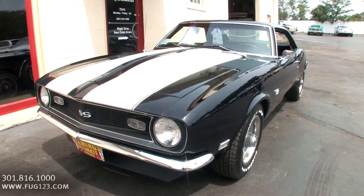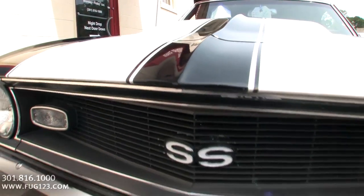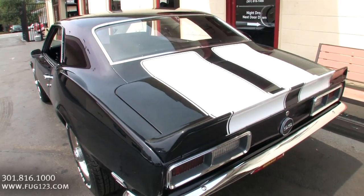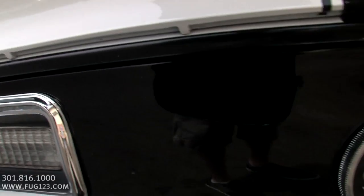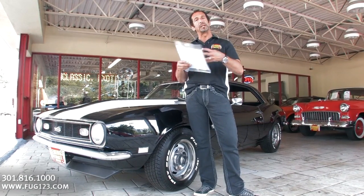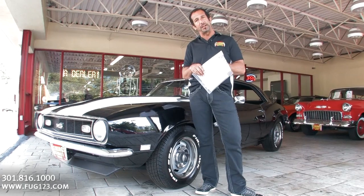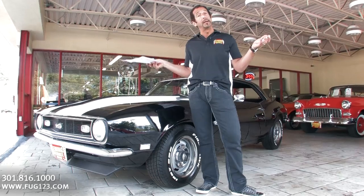One of those things I love is tuxedo black paint. You've got to love black paint. Everybody says they want a black car, but you have to put a little effort into getting a black car to be a beautiful black car, and I want to show you why. Most people don't understand — it's not the paint you put on the car that gives you the black. Most of us can probably paint some black on, wet sand out whatever dirt and dust is in there, but really it's the body prep. It's what gives it that flat surface so the black paint can really reflect off of it. I get teased a lot because I show the paint quality of the car, but that's actually my signature. I want you to see if you're getting an ugly paint job — you need to know it. If you're getting a great paint job, you should definitely know it.